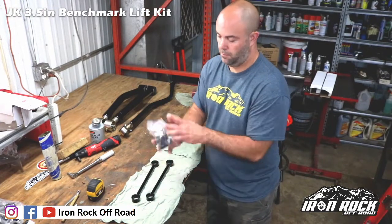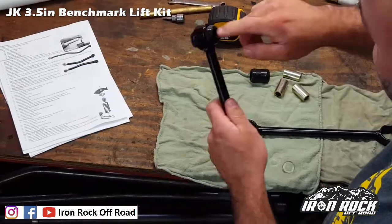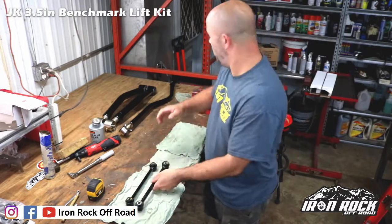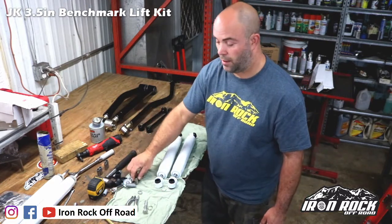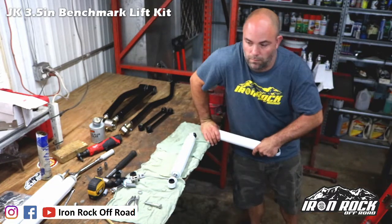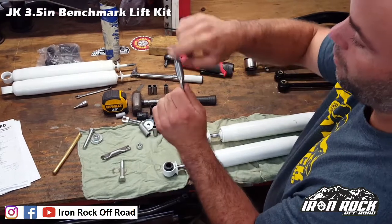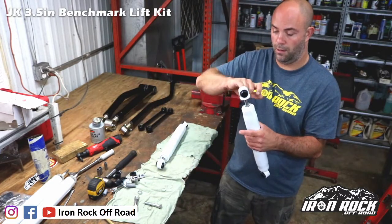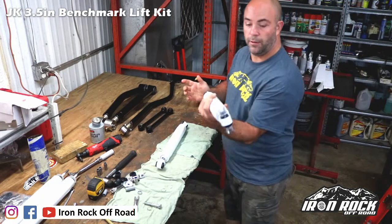Next up is our sway bar links — just a light coat of multi-purpose grease inside. Then the rear shocks, using hardware kit 165 for the bar pins, with shock sleeves in your shock hardware. The lower side gets the 12mm shock sleeve and the upper side gets the bar pin. We ground down one side so it's angled for insertion. Grease up your bushing well and set it standing up on the vise. Rear shocks are ready to go.